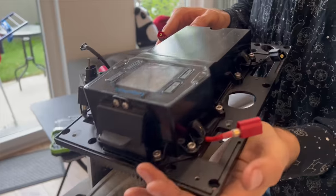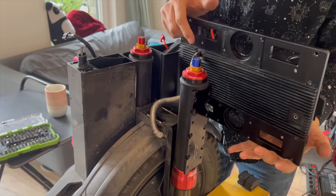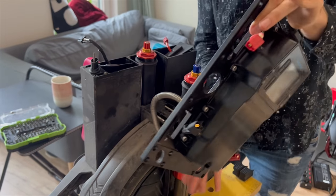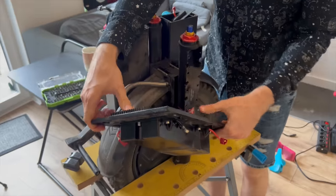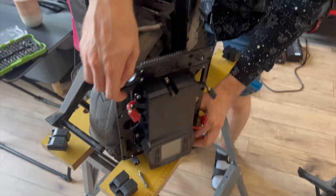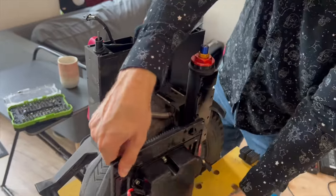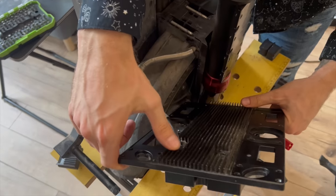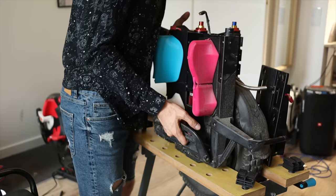It's not an optimally easy tire change since we have a lot of screws, but at least we don't have to remove the phase wire connector — this can just dangle and you can change the tire without disconnecting the phase wires. There's also a big heatsink here on the bottom — clean. This top plate holds both halves together. I wish it would be a bit more structurally sound, but it's pretty thick so I hope it won't be bending or breaking upon falls or longer wear and tear. There's also additional structural support from the pistons connected to the motor.